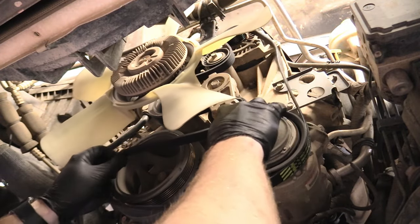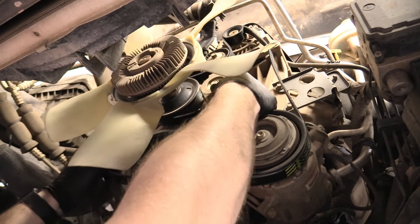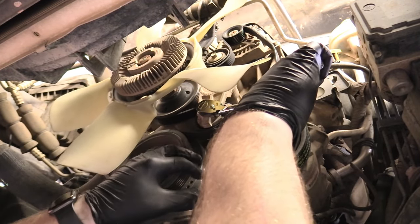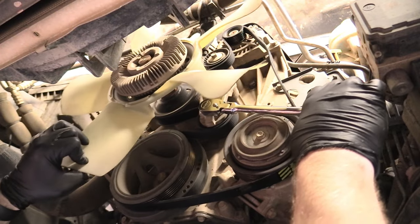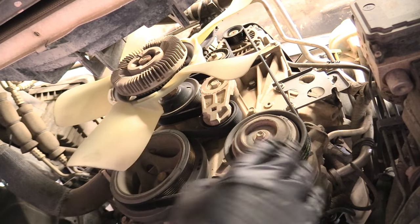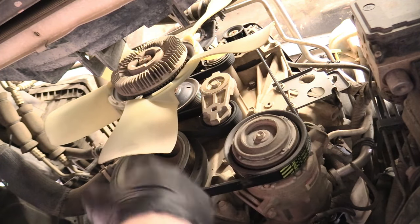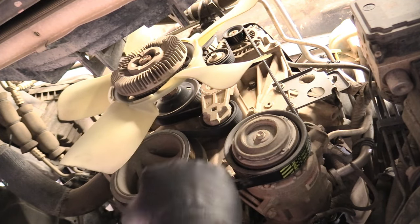Put this around like this — so now the routing is correct, but it's not going on because we need to put tension on our tensioner. Have it come over so we can get the last pulley on. This is usually a struggle, so don't be upset if you don't get it on the first try. Once you're at this stage, don't just let it go — be nice and gentle. Then go around with your hand and make sure all of the grooves are on all of the pulleys, all the way around. If it's off by even one tooth on the side of a pulley, it'll just walk right off and you'll be back at square one, or worse, something gets bound up in the fan or an accessory and breaks it.